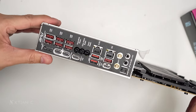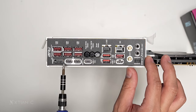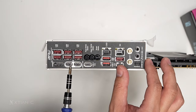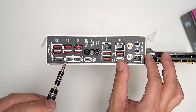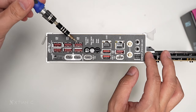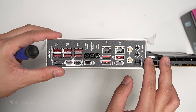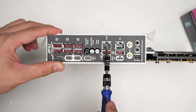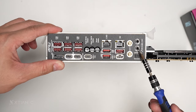Checking the I/O panel: we have nine USB 10G ports, two USB Type-C at 10G, and two USB-C at 40 gigabits — that's USB 4 with PD charging. There's also an HDMI output. In the middle area, there's a BIOS flashback button, CMOS clear button, and a smart button. We have both 2.5G and 5G LAN ports, Wi-Fi 7 antenna connectors, and high-definition audio output.